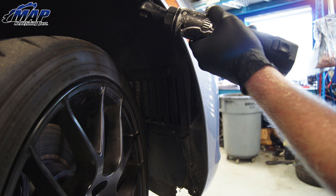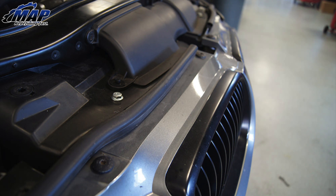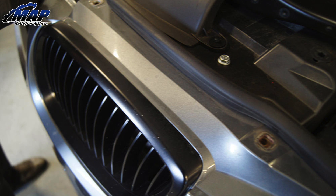The first step in removing the bumper is to remove the three 8mm screws attaching the fender liner to the bumper. With these removed, gently peel back the liner and remove the two 8mm screws that attach the bumper to the front fender. After that, remove the under paneling attachment screws — they are 8mm. Then remove the T30 Torx bolts on top of the bumper that attach to the core support.